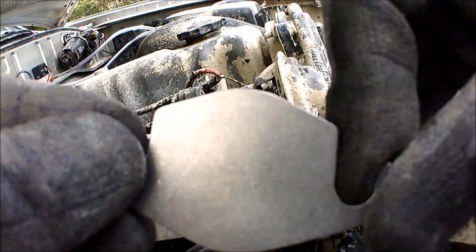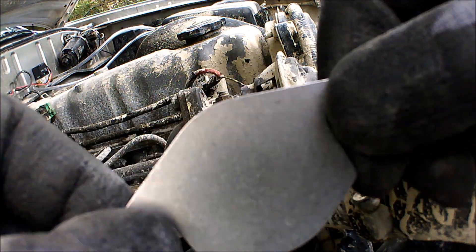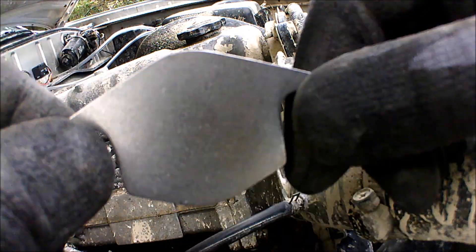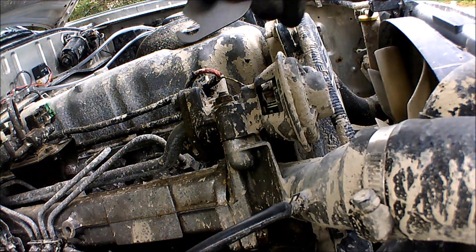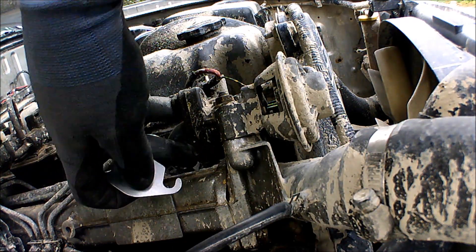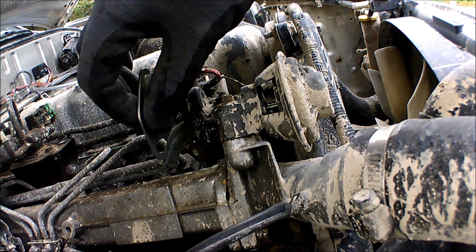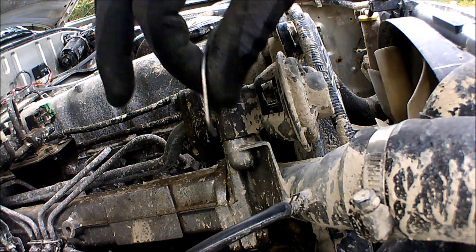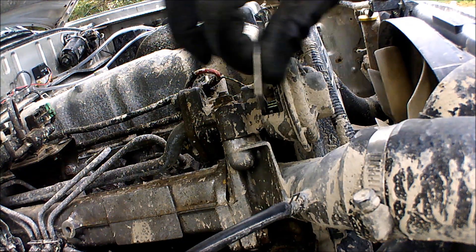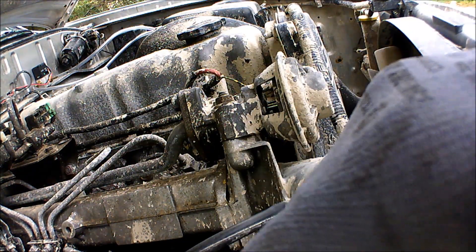Take the plate out of its packaging. Simple blank plates - it's a phase 1 Ranger that I've got here, with a mechanical fuel pump, so it doesn't need a hole in the middle or anything like that, and I am planning on removing the system when I get a chance. All we're going to do is unbolt these two 12mm nuts here - that one, that one, and that one. Slide the plate in without fully removing the bolts; it's going to go on the front rather than the back of the gasket that's in there, and then we're going to bolt it back up again.